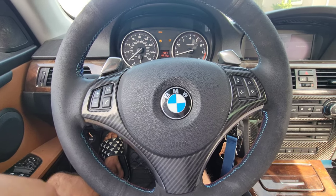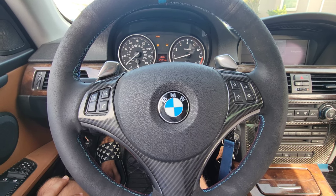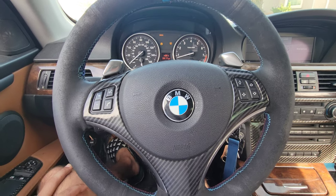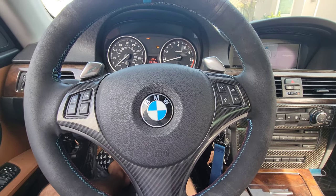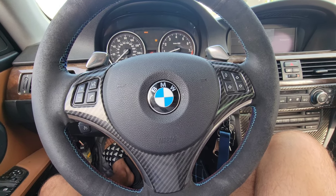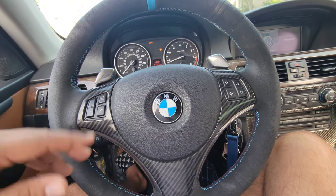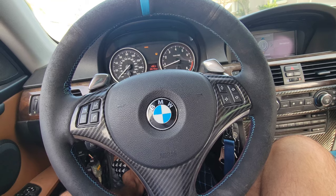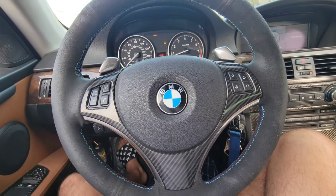There's a weird little transmission glitch that just happened right now. I'm gonna go ahead and plug it in and check it, tell you guys what happened, if there are any codes or anything. It's for sure one of the best mods in my opinion that you could get. So I'm back. I guess it was a fluke. There are no stored fault codes. It was weird how it was in fourth gear and wouldn't go down to first gear when I had a dead stop. Not sure if that's still it learning.